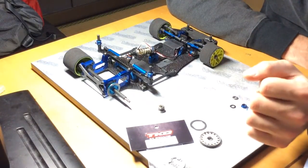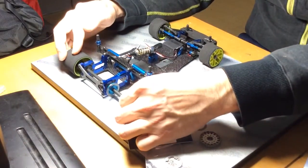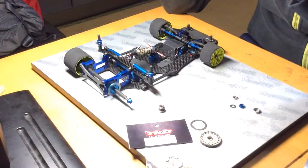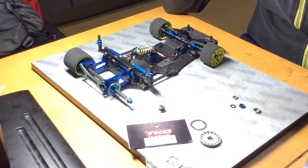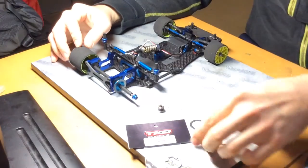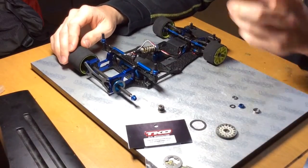When you assemble everything onto your axle and you're ready to go, you want to make sure that when you are applying pressure with the wheel nut, especially on a freshly made differential, you don't just drive the wheel nut in and compress the differential unit tightly. You want to gradually have the differential rings work themselves in. So what I do is freshly built, throw everything on there, start tightening the wheel nut, check to see how close the two plates are to touch the center of the differential. And then once it just touches, I start to gently apply pressure and rotate the nut in.